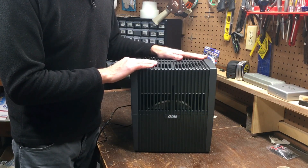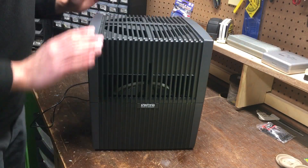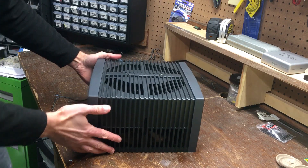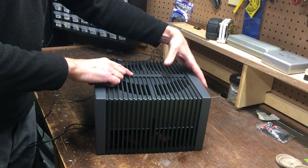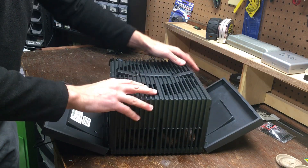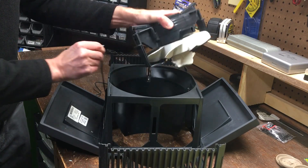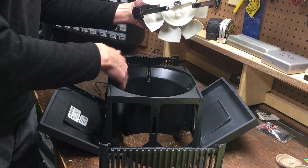So now I'll show you how to flip the gear and make sure the coupling is in properly. I've unplugged the unit. Now I'm going to lift off the upper housing and remove the lower housing. To open up the upper housing, you press on the two tabs on either side of the power and fan speed buttons, pull back the solid sides, then flip back the slotted sides. Then you can lift out the fan motor and unplug it. While you've got it open, it's a good time to take a dusting cloth and clean off the fan, the motor, and the inner housing.